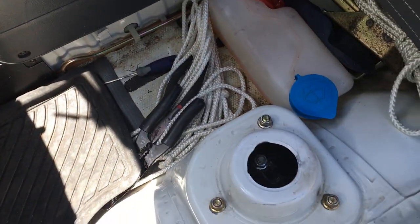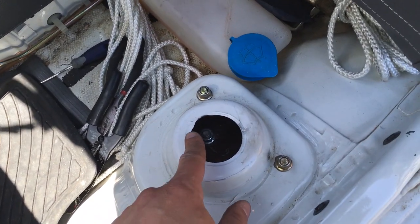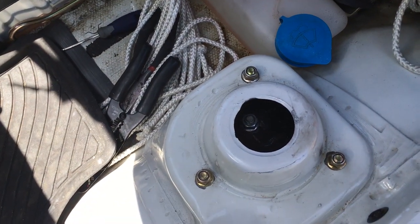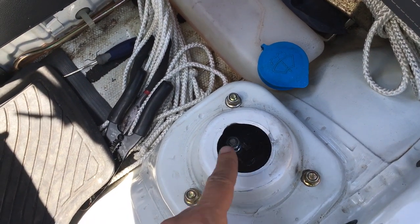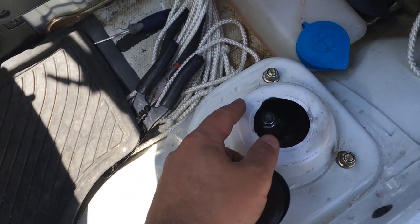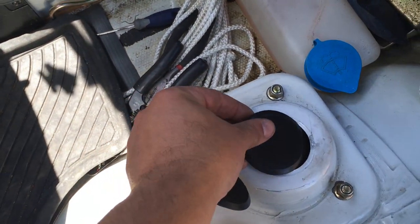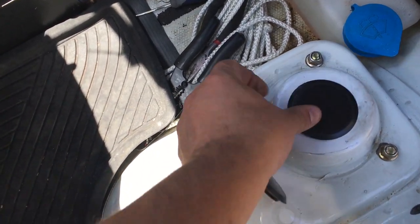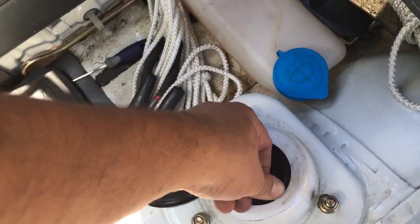Hey guys, so I just want to show you, a lot of people hack the top of their strut towers here. They just rip it apart and cut it with a grinder or whatever it might be. I bought a nice hole saw to do it, and even though it looks like it's uneven, this is actually a 2-inch diameter hole. I just got these plastic caps, and these are a perfect fit. I mean, it looks like factory now. Just gotta snap it in, but there you go.